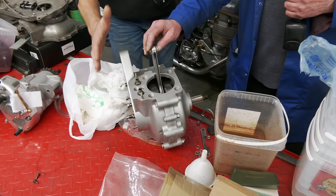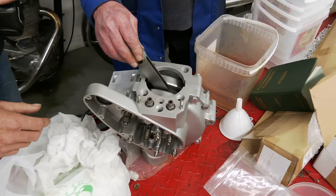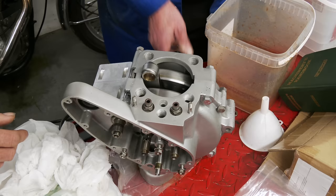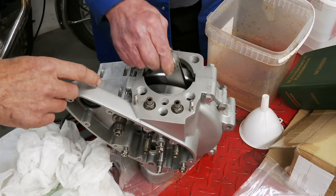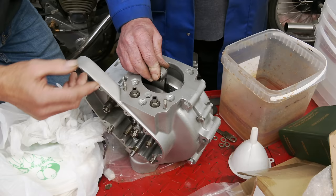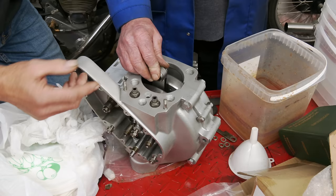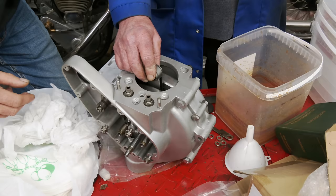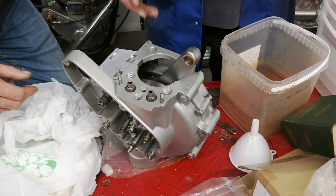This is the original engine that came out of Phil's Gold Star, and it's a little bit special - it's got the oval crank in it. You can see it come round the oval as it spins. Phil has been doing oval cranks for quite a while, though he doesn't like making them because it takes another day. The advantage is that it misses the skirt of the piston when it goes down - so you could have a longer stroke or longer piston. They're 8-inch flywheels reduced to 7.1 on the ovality, because you want more inertia in the flywheel.